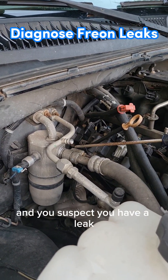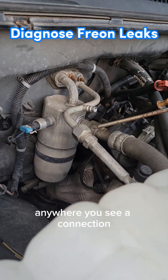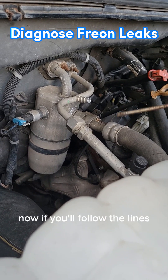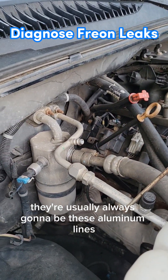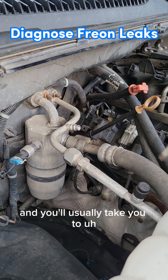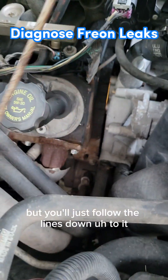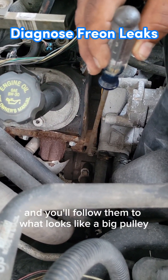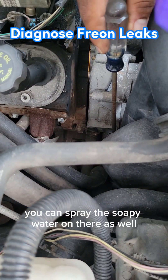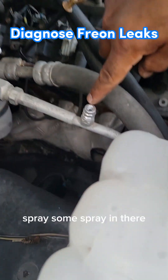Another thing you can do: when you fill it with Freon, if it's not leaking there but you suspect a leak, spray all of your connections. You see these connections here — there are O-rings there, and anywhere you see a connection there's going to be an O-ring, all the way down to your compressor. Follow the aluminum lines — sometimes they go into rubber sections, but they're usually aluminum. Follow those lines down to what looks like a big pulley — that's your AC compressor. You can spray soapy water on there as well. Same goes for the high side — unscrew the cap, spray it, and if it bubbles, you've got your leak.